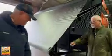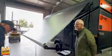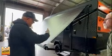What we do then is we get this hook, put it in the strap and pull it outwards. Now that strap should be in the middle of the awning, but we'll sort that out when we put it back. There we go, that's come all the way down. And it's just a track system anyway for the strap. This disengages the gears, that's all it does. So it's either going up or it's going down.